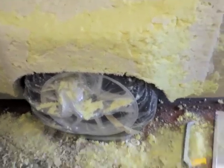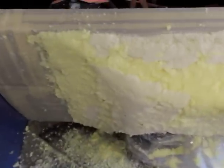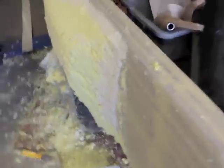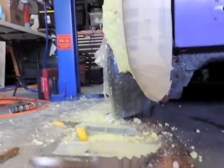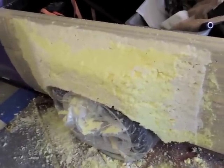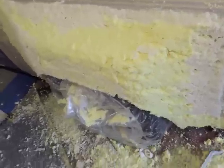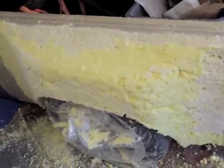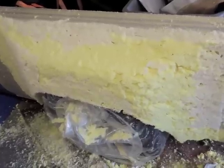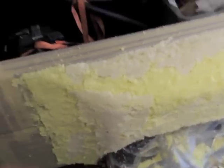The basic shape of the overfender is all done. It's still in pretty rough form but it's pretty close and it looks pretty damn good from the back - look at all that tire under there. Next step, I'm going to use drywall putty and mud the whole thing in to get rid of all the big cavities. I'm using drywall putty because doing it with body filler would be over $100. Instead I'm spending about 20 bucks on drywall putty, and it sands a lot easier too. I'll do a time lapse of applying that.